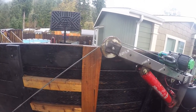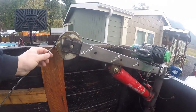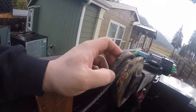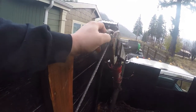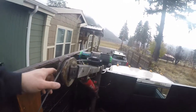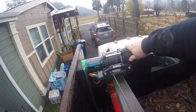It had a crappy little block out here, so I took a cheap winch snatch block, cut the little ears off of it, and welded it in. When I switched to synthetic rope, I bent some round rod and welded it in to get rid of any sharp edges, and it also prevents the rope from getting in beside the pulley track.